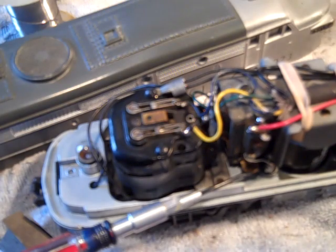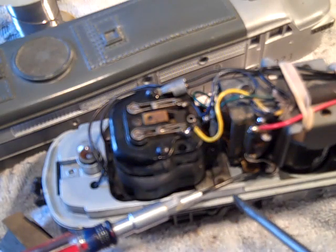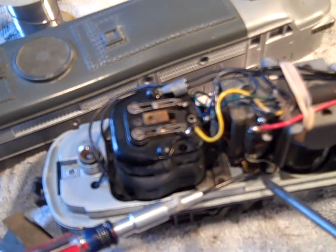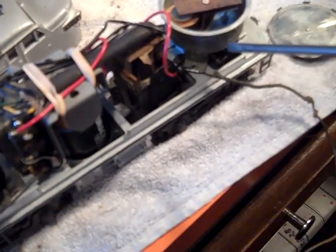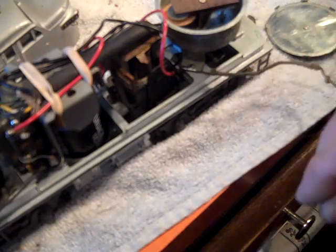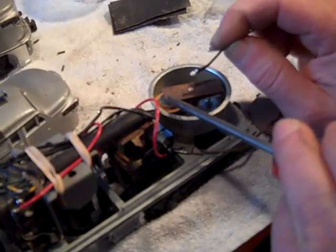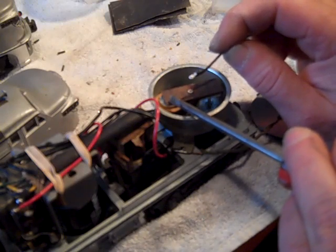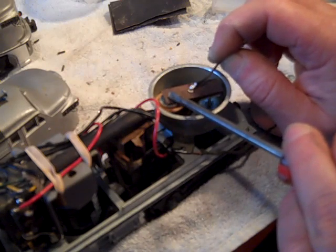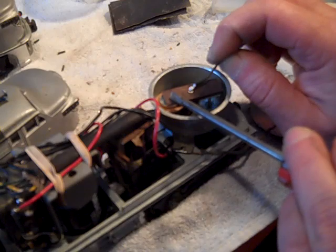I've cleaned those contacts up with sandpaper and made sure they're as nice and clean as I can get them. I've got this little screwdriver just wedged under the bottom of the armature, pushing the contact up to the horn relay making the circuit, and I've got a piece of wire grounded to the frame. You have to have the movable arm in somewhat close proximity to the coil. You can see now that it's working and seems to be working pretty reliably — I feel confident this is going to work when I get it back together.